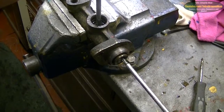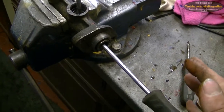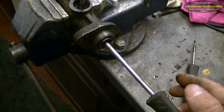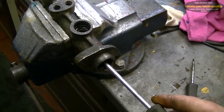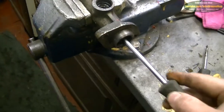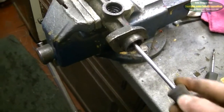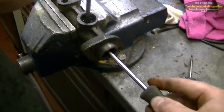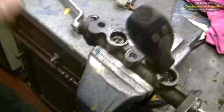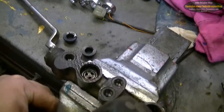If you've got a big servo assist, which is what I've got on mine, you'll have a servo assist there which helps — when it detects you pushing it in, it undoes a valve and floods a chamber with a vacuum, and pushes a diaphragm on this bit here. And now that one works the front brakes — so it moves to there, and then that stops. That's your brake off; that's your brake on, and that just activates your front brakes. You can see that thing there moving.